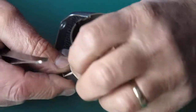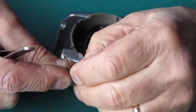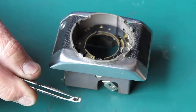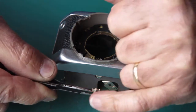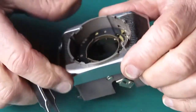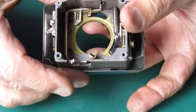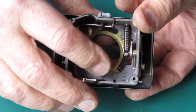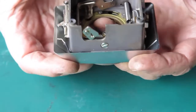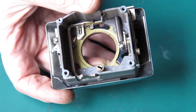This pinion can go in either way. It's not symmetrical — by that I mean the line of the tang on the end here is not in line with the end at this point, so we may have to hit and miss to get that in place. The neutral position here — I'm looking at the angle of that slot at the back and I'll take note of that. I'll stop here while I get a photo for my record.